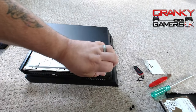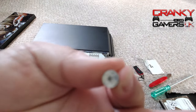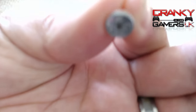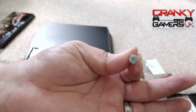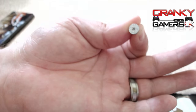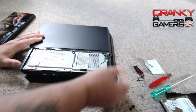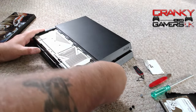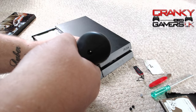What we're aiming for is this little beauty here — one screw, that's all you need. I want to show you the screw — it's got the Sony emblem on it, got all the little controller symbols on it. That is the only screw you need to take out. Then you grab this little caddy handle and a gentle pull — and that's it, that's the Sony drive removed. Again it's four screws on the drive itself.